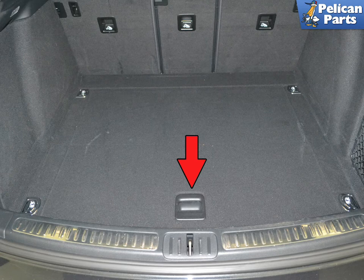You're going to be removing the glove compartment along with the attached lower airbag, so you're going to need to disconnect the ground cable on the battery. Do not attempt to work around an airbag system with the battery connected. Before you disconnect the battery, every time it is disconnected it needs to be reprogrammed into the ECU for the Macan's function. If you do not have a scan tool to do this, you will need to get or borrow one before you start. If you are planning on DIYing your Macan, a scan tool is a good and wise investment.